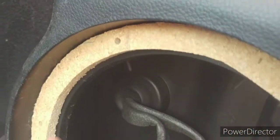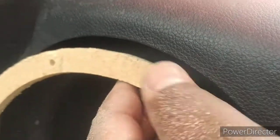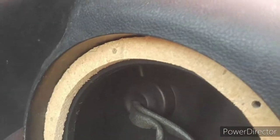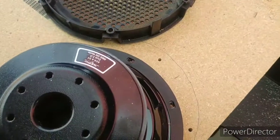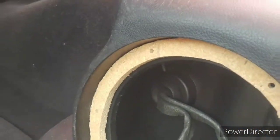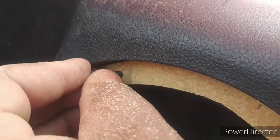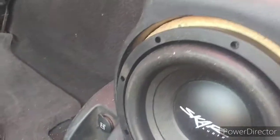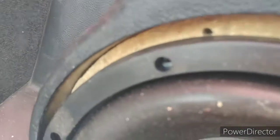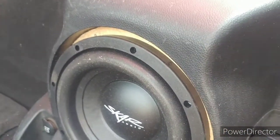Now I'm going to put it inside and fit it in there. Basically it's going to keep pushing the speaker out further and further — I might put another one on, but I want to see how the first one fits. That's my first one right there, and these holes all match the holes already inside of your Jeep, so you'll be bolting this to the Jeep. You'll screw your actual speaker to this. I did my fitment test with one and there's a small gap back there, so I'm going to make my second one. I just wanted to confirm I needed two and not just one.